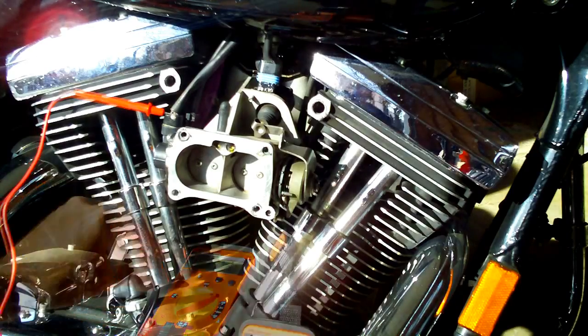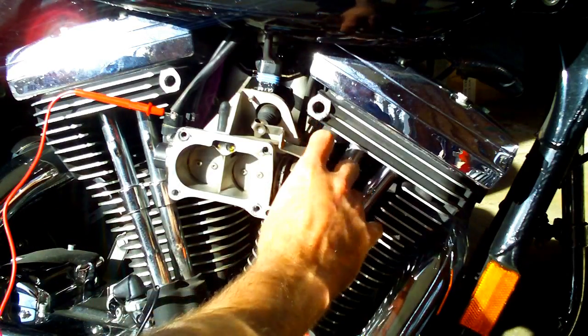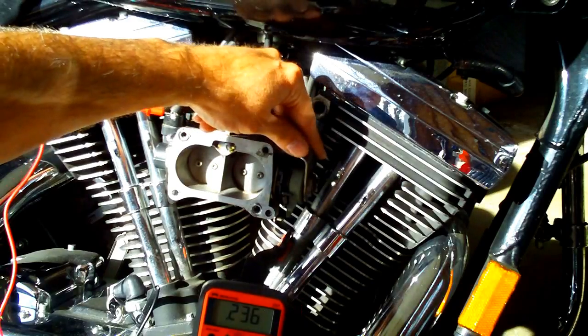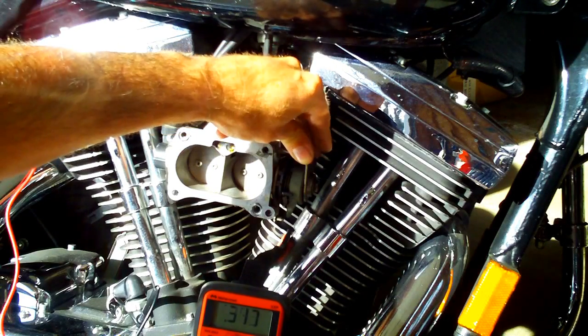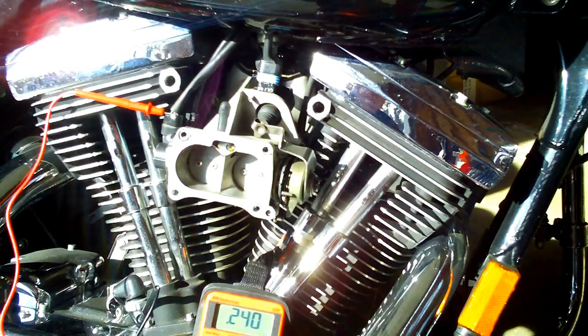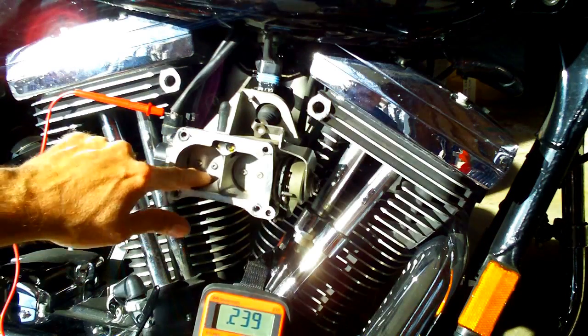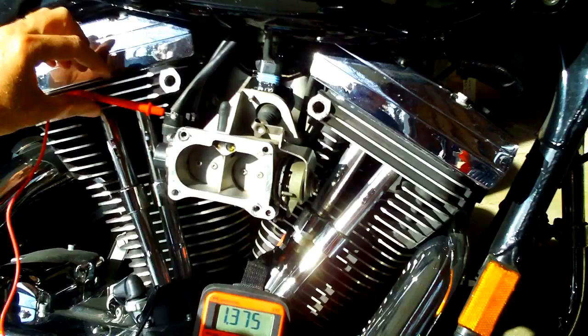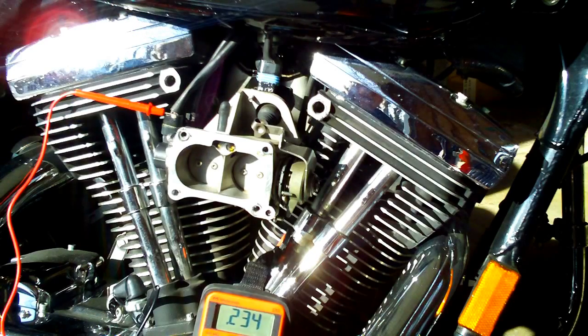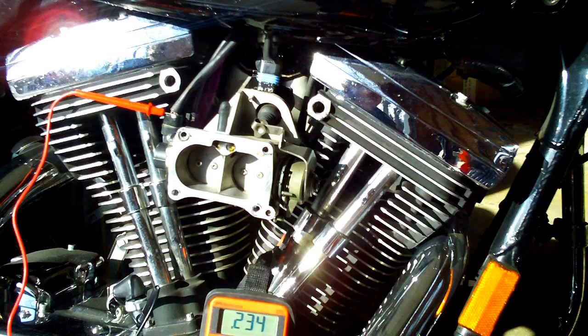Reading 232. Making sure you can see the numbers — the numbers do change as you rotate, and I have overload as you rotate the throttle. So with it in its relaxed position and the multimeter on the wire from the throttle position sensor, what we want is 0.275.